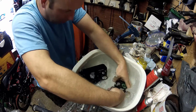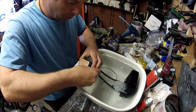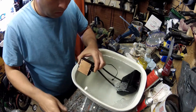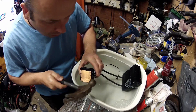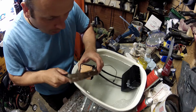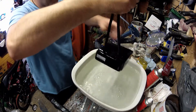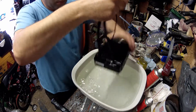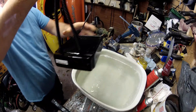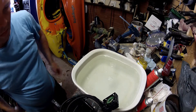Once you're at the stage where you've got all the air out, you can put the coupling back into the pump unit itself. Once that's done, pop the pin back into the coupling — be careful not to hit the copper plate. Then remove it from the water, allow it to dry, and stick the last couple of covers back on and you're good to go. Because you've used deionized water, it shouldn't conduct either if there's a leak. Any questions, feel free to ask.